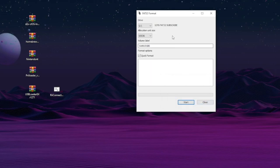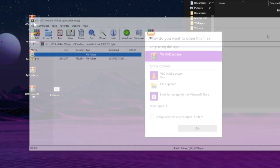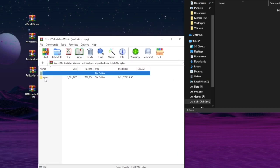Right now we're going to focus on the SD card. Once it is formatted to FAT32, open it up. Then on the root of the SD card, you're going to need to make a folder named apps. Open that folder up and find where you downloaded the rest of the files that are linked in the description.